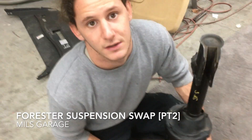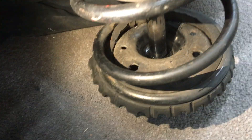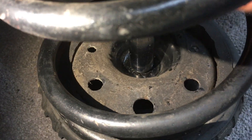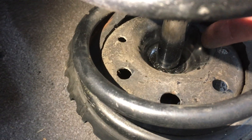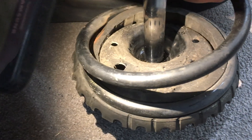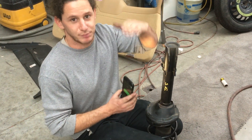We're having issues with lots of clunking and loud noise from the new suspension. We changed over the top hats. I don't know if it's not tight enough, or there's a little gap in between the shock rod and the top hat - right at the very bottom. It's really hard to see, it's not really that much of a gap, it's like an eighth of an inch, but every time the shock compresses just a little bit - bang bang bang.